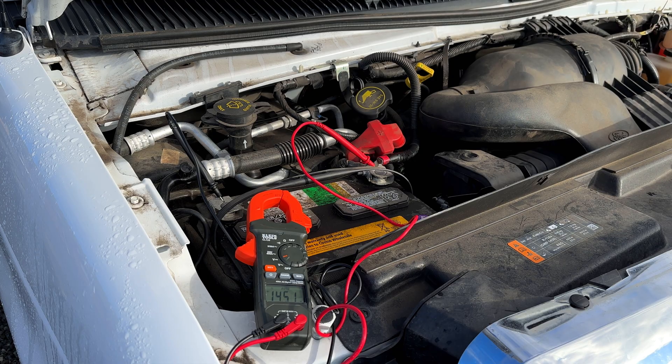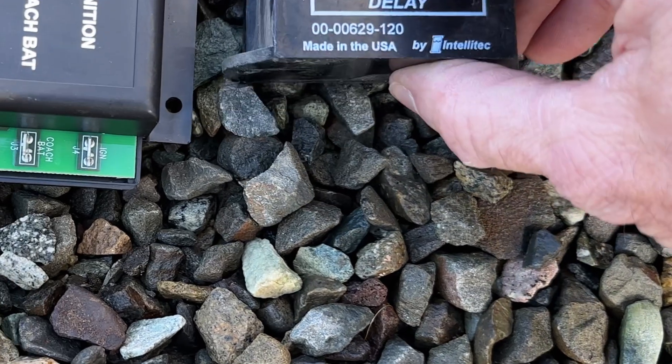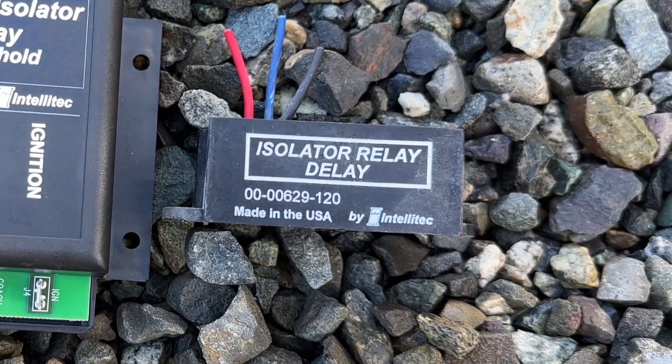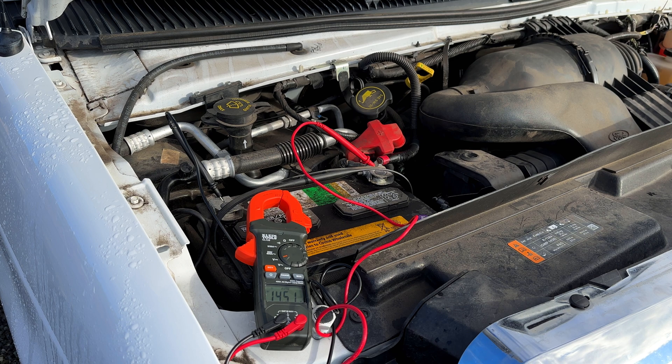Now while the engine is running, the alternator is able to charge the chassis battery and the house battery at the same time. Right now it is charging all three batteries. The problem is they've got a unidirectional relay — it only allows charge to flow in one direction. So we're going to take out the unidirectional relay and replace it with a bidirectional relay. Once we're done, we should be able to get charge at this chassis battery while she's plugged into shore power, and the battery should not go dead again. We will confirm with a meter when I'm done. So let's get started.